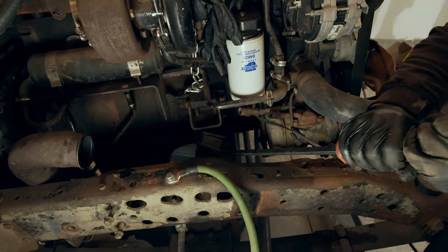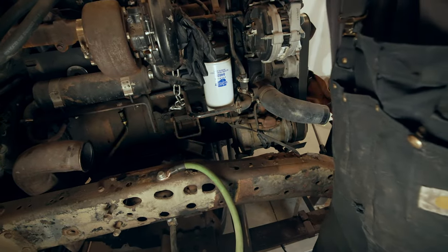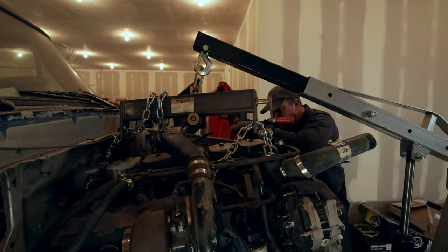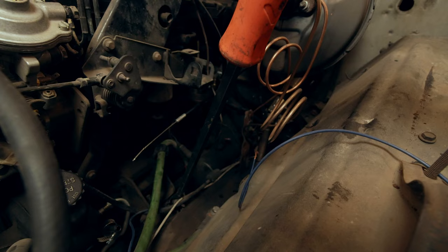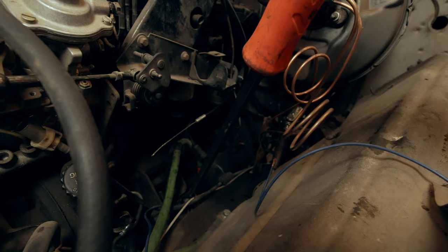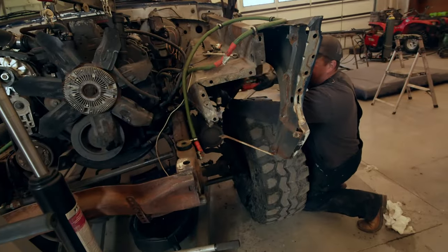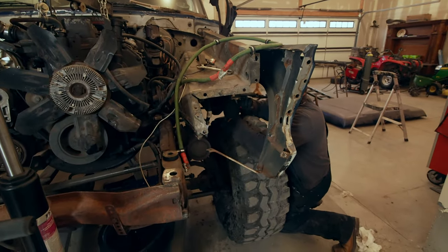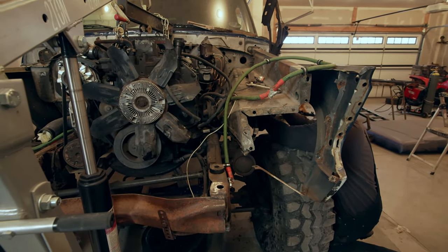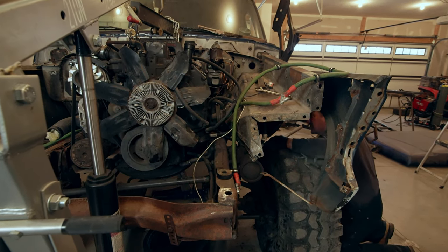Oh, something happened. I don't know if it's good. Dang. It's definitely coming forward. It's kind of up above that spot on the cab I was worried about. It wants to come forward. This side doesn't want to move. This side is just hanging us up. So this motor mount's really hanging us up. It's not budging at all. So we gotta figure this out. I wish this other side was the side that was holding us up, because I can actually get into that side. This side's got the fender in the way still. Is that stupid starter holding us up?